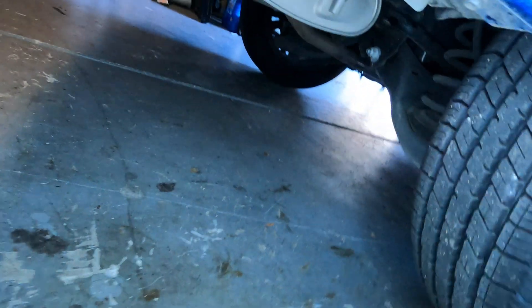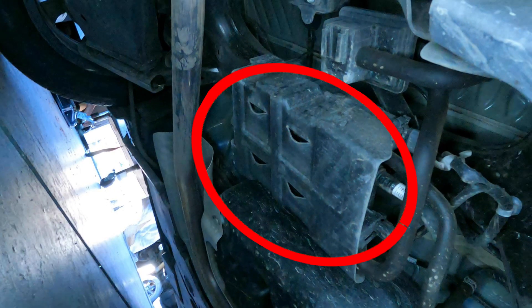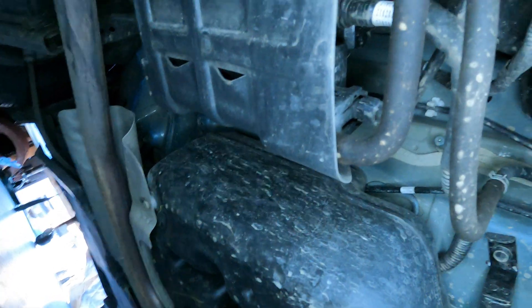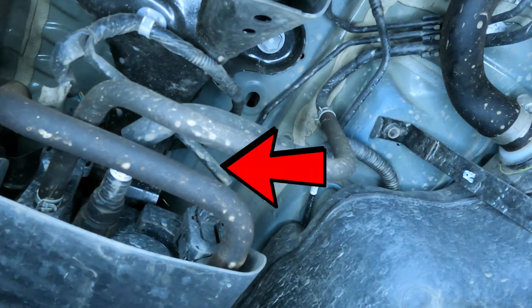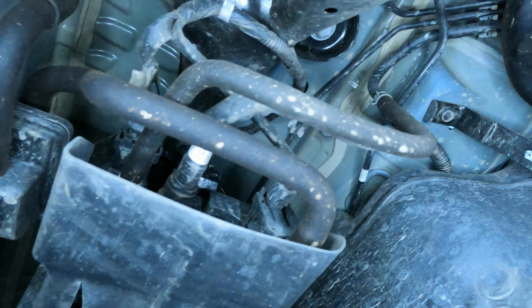Coming to the passenger rear of the vehicle, there's a lot going on under here. If you're having a problem pumping gas, this might be your issue down here rather than anything up under the hood. Here you're going to find your vapor canister — that will store the emissions vapors and then allow them to be pushed up into the intake or back into the fuel system as needed. This filter right here, if it gets clogged, will make it really hard to pump gas. So if you're having a gas pumping problem, I would check and make sure that filter is cleaned out — maybe just disconnect that hose from the filter and see if it's easier to pump gas. Right here you're going to find the vapor vent solenoid. This will allow vapors built up in the canister to flow through the black hose and go through the filter and then be released to atmosphere. If this vapor vent solenoid goes bad, it will also cause problems while pumping gas. So this is almost all of the emissions components on this vehicle.